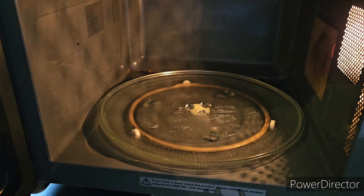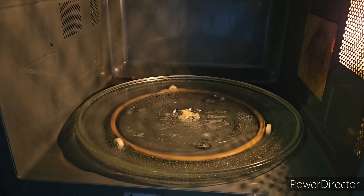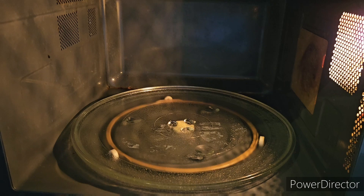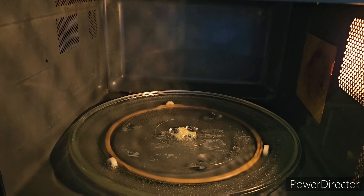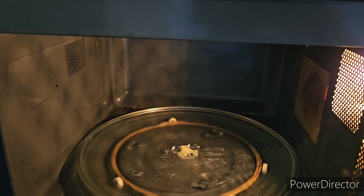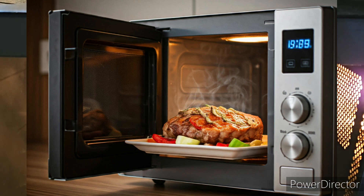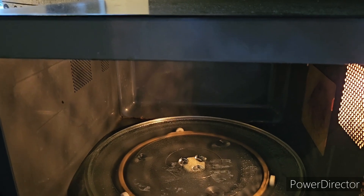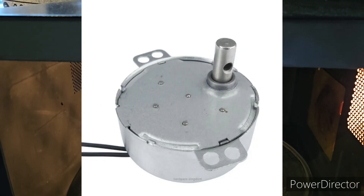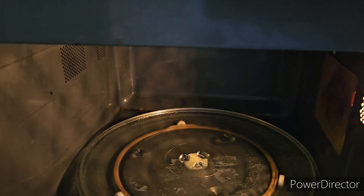So how do you resolve the issue of standing waves bouncing around inside the Faraday cage not heating all parts of your food evenly, clearly not hitting all parts of the food inside? The problem was solved using a rotating plate, which moves food evenly through the standing wave, ensuring your food is heated evenly all the way through — inside and out. Early microwaves used to insert a rotating plate until they moved to the internal plate powered by a synchronous motor, which gives a set number of rotations per minute, commonly around five to ten.